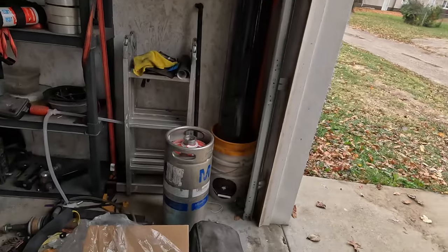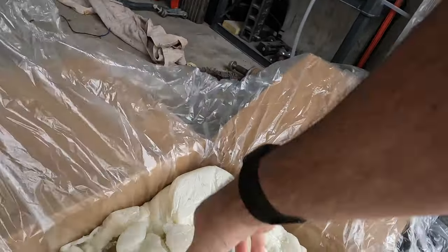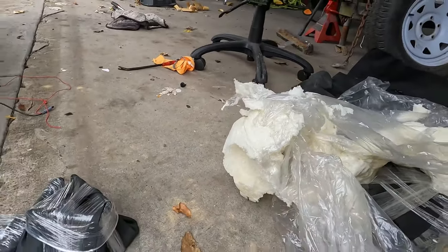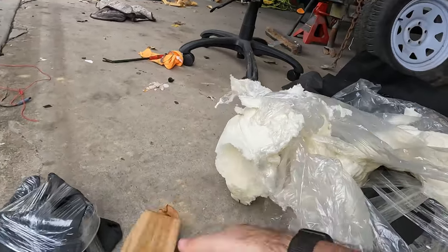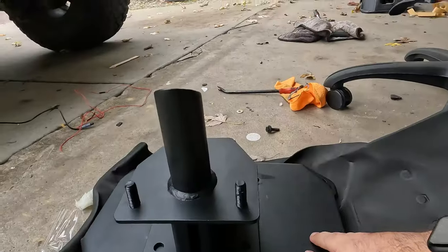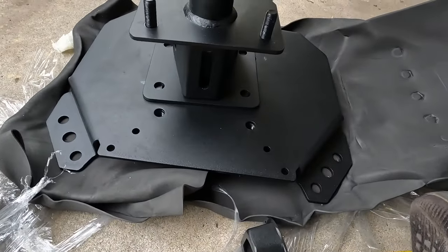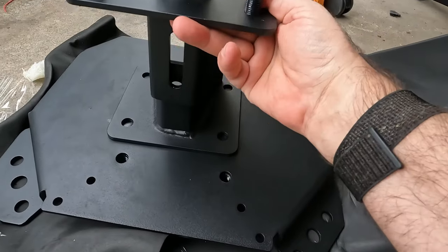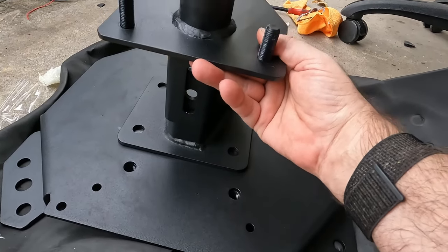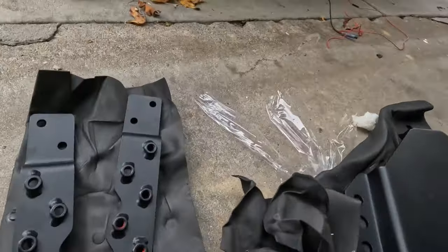What we're going to do is install the Turn Off Road tire carrier. We've got this box here with several components: this would mount to this like so, and then this sits on here. This is adjustable so you can slide it out or in as much as needed depending on your wheel offset and tire size. Then the camera will sit like so.